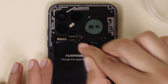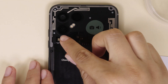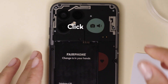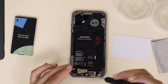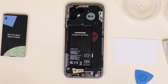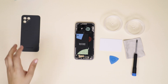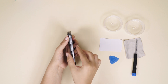Reconnect the BTB camera connectors, starting with the one that will be hidden by the other two. Insert and connect the lid from left to right. Insert and tighten the remaining silver camera connector lid screw. Now you're ready to put the battery back — make sure to start with the top and lay it down. Then click the back cover back in place and press along the sides with your finger to make sure the fit is snug and secure.